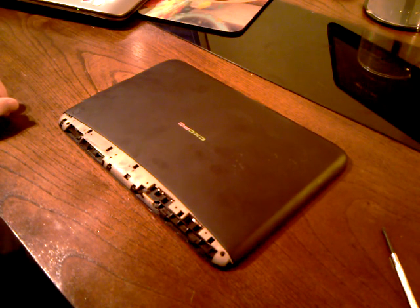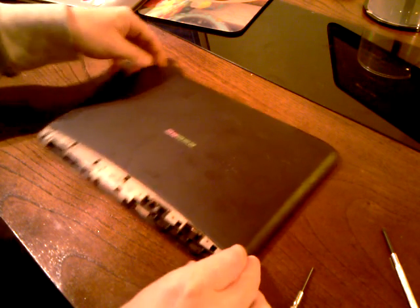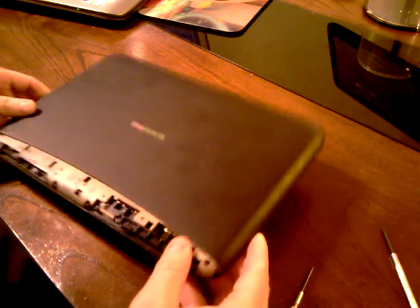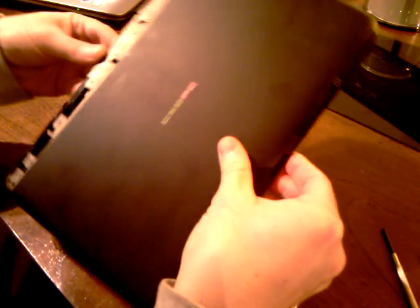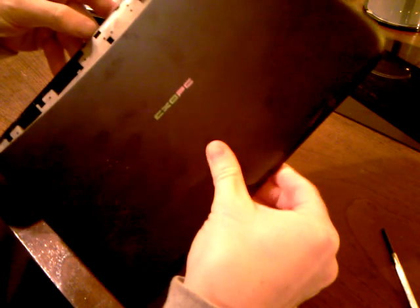Now this is actually the tricky part. There's a couple of hooks — I don't know if you can see — just here and here, which are the tricky clips. Basically what you do is take the front of the screen in your left hand, and in your right hand you want to with your thumb move it to the right — so push with the left and pull with the right.